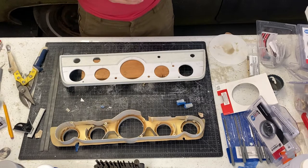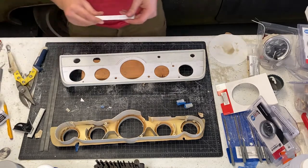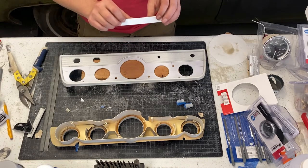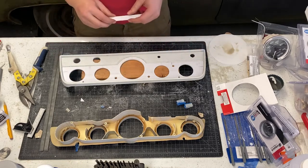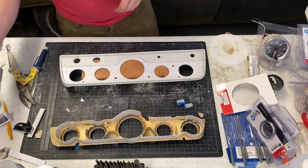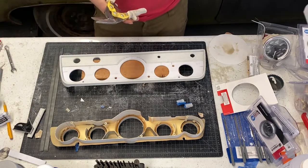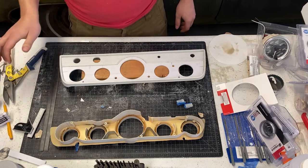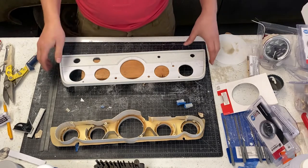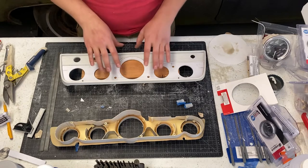So what I want to do is map out where this reinforcement's going to go. We'll take little strips of our Kydex and use the heat gun. We'll do contours. We'll make it nice in there. One thing I found is my little saw blade likes to wander off, but tin snips actually cut the Kydex pretty nicely. So I'll cut a big long strip off the straight edge that's left. That way we've got a nice reference edge when we go to glue up, and it's nice and flat.